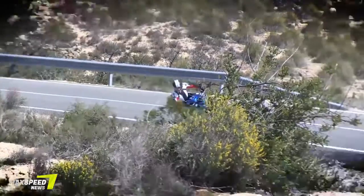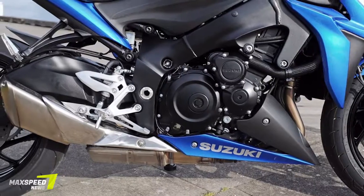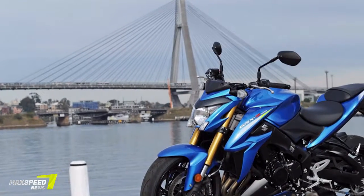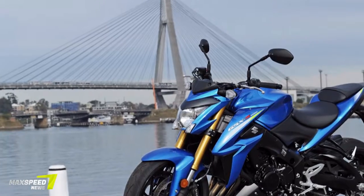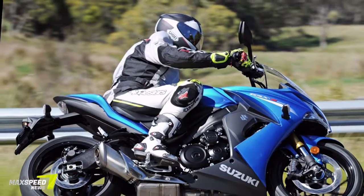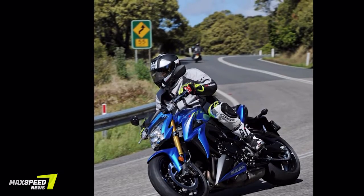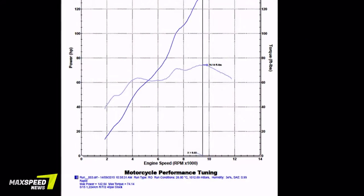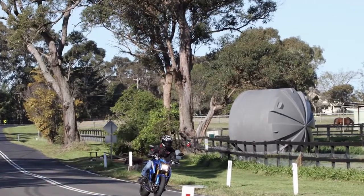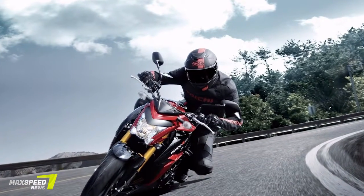The 999cc inline four-cylinder engine is in fact taken from the 2005-2008 GSX-R1000. Suzuki says its long stroke design promotes low to mid-range urge, making it ideal for street riding, while the compact crankshaft and gearbox layout meant Suzuki boffins could minimize the weight of the chassis. The unit produces a claimed 145 horsepower, 107 kilowatts, at 10,000 rpm and 106 Nm at 9,500 rpm. That's down significantly from the original's 175-ish horsepower, but believe me, there's plenty untapped to play with.